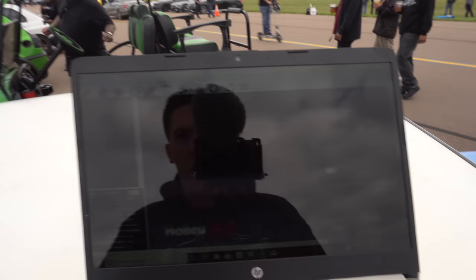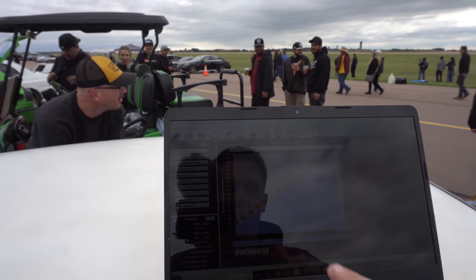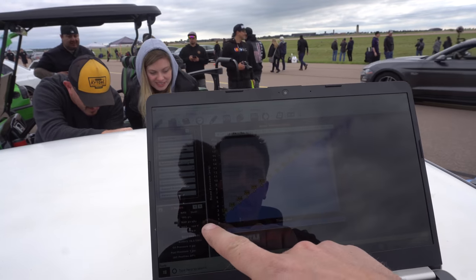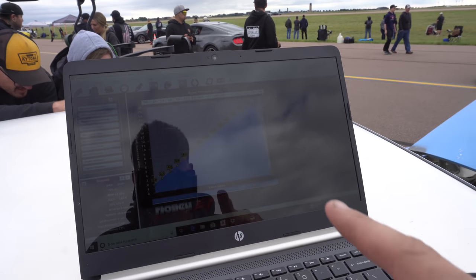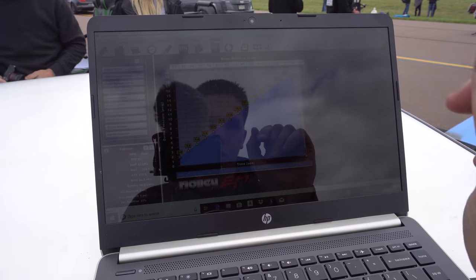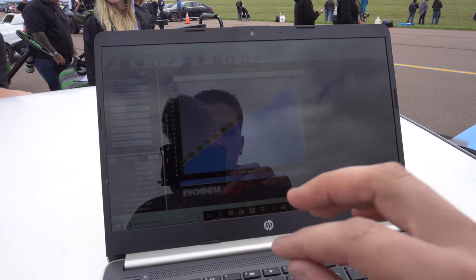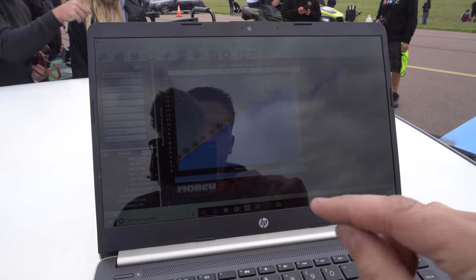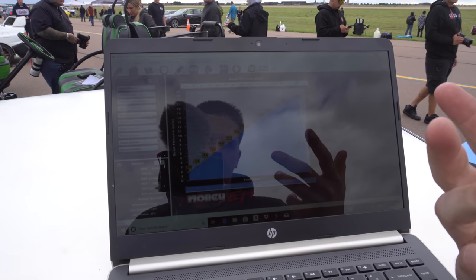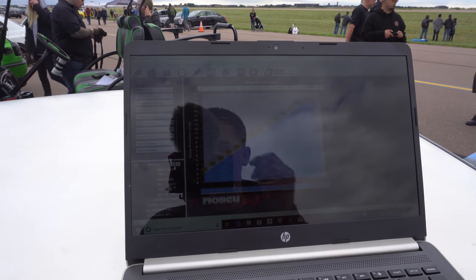So first thing I'm going to do is come into the Holley, and we're going to open up the boost ramp. On the boost by time, what I've had is it out to about 8 to 9 seconds. I'm probably going to go out 20 and just make it a linear graph, and we'll see what it does. And if it spins or whatever, we'll come back in and adjust some stuff. But we're trying to be middle of the ballpark on what we're going to do to try to go 200. I mean, just a guess, maybe this first pass should have 180, 185 mile an hour in it, pretty easy. And then we'll just have to see what it gives us.